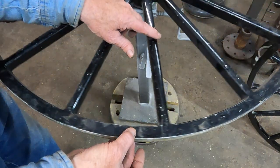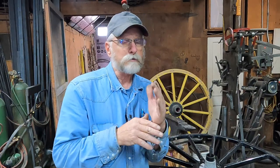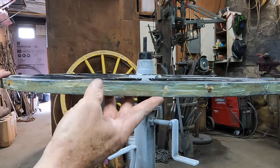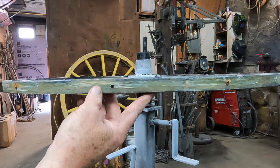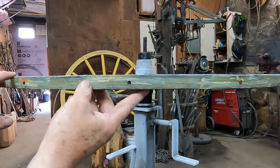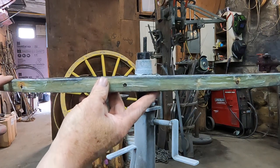It's all cast one piece. You probably remember as well that in all wood wheels there is a concave dish effect. When the wheel is sitting on a vehicle, that dish is pointing away from the body of the vehicle. The whole purpose of that is to withstand side thrust so that the hub is not pushed through the tire or the wheel and collapse the wheel. These fiberglass wheels also have dish, but it's cast right into the mold. You can see that the center is below the flat plane from one side of the rim to the other — that's what's referred to as dish.